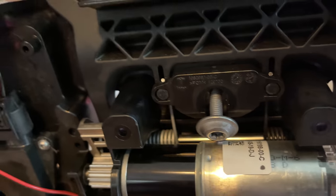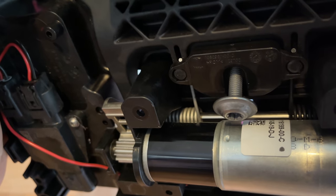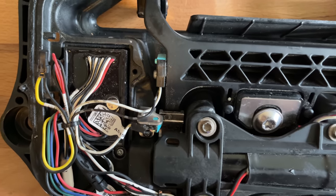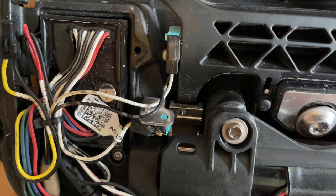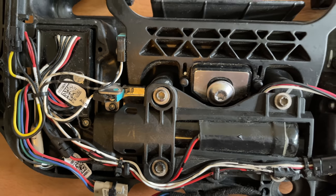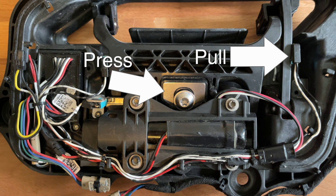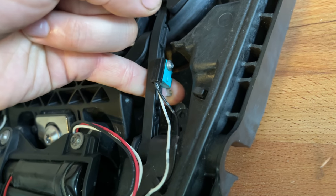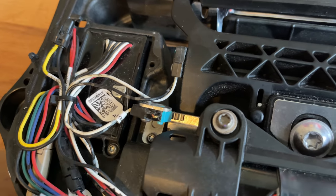The gear doesn't directly move on the handle — the gear-driven arm and the linkage are separate. If a high-torque gear motor were to move the linkage itself, it would crush your fingers. The handle actually returns home with the force of a spring, so you can stick your fingers in there and it won't chop your digits off. But how does the door handle know when it's all the way out or all the way in? Well, this is the part of the design that's not so great. There are two micro switches — one that clicks on whenever the handle is stowed, and one that clicks on whenever it's deployed. There are also two pressure switches: one activated when you press the handle, and one activated when you pull on the handle. The door mechanism is not on the dry side of the door — it's exposed to the elements, the dust, and the rain.